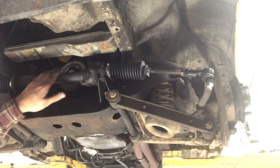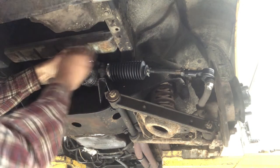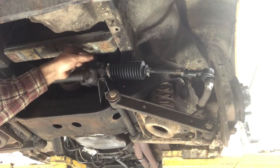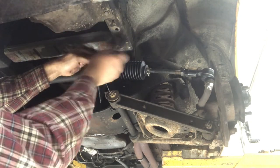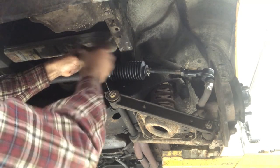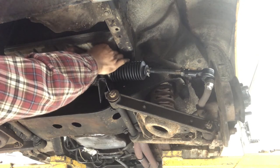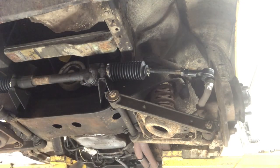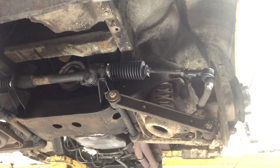These do take 80W90 gear oil. The way I like to fill them up is you take this plate off here, which has two 5/16" bolts — so you'll need a half-inch wrench. Underneath that you'll find there are some shims. Now if your steering rack is loose, if you have a noticeable amount of slop in your steering, you can actually take one of these shims out when you go to put it back together.